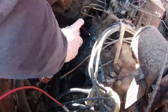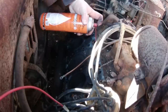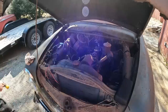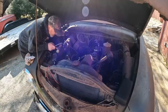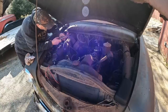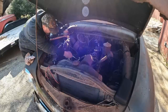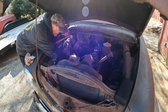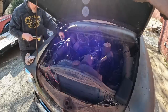We're gonna soak her. Now, okay, this has some type of corrosion in it. I can see that, but it's not terrible. Well, I was looking for a brass punch, but I can't find one. So I got a nylon head and a rubber head. I mean, if I hit it square with a drift or a punch on the top, and I just hit it dead center, it really shouldn't push the sides out, right?